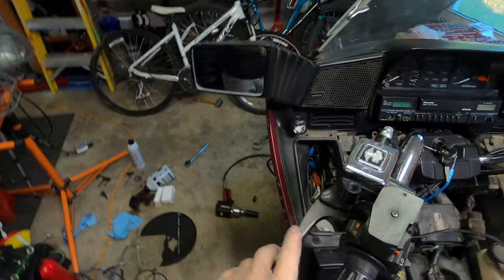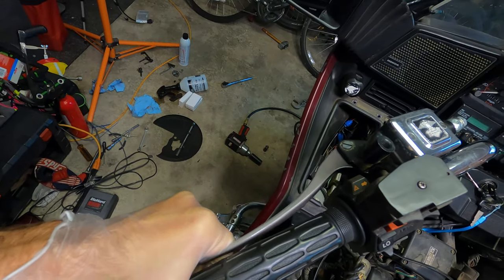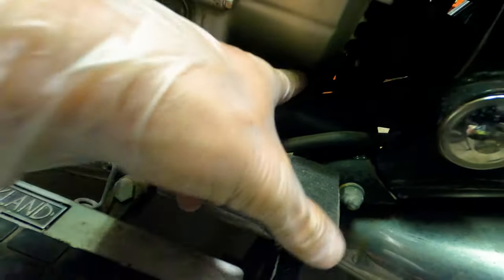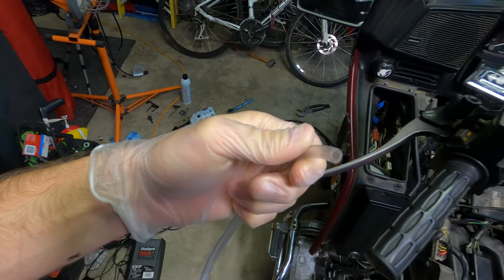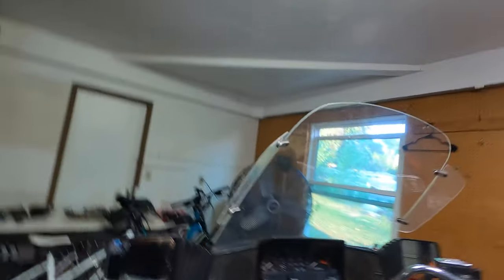Gold Wing clutches are not easy and I'll show you why. Right now the clutch engages right about here — I need it to be engaging out further where it should be. The fluid is also piled so bad it probably doesn't hurt to flush it. You open up this reservoir and the bleed valve is deep in there — I have to take off this black box to access it. This is what I use to bleed any hydraulics — you put it over your bleed screw and it catches everything so it's not going everywhere. I do the same thing for brakes.